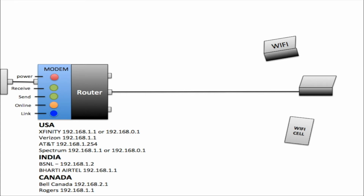Now this diagram is a basic representation of what your local area network would look like. Your modem would be connected to a wall jack with either a cable connection, which is the coaxial cable connection if you have cable, or a telephone type line if you have DSL. And now this is your modem. A lot of modems are combination modems, which have a modem and router incorporated into it so that you can actually have Wi-Fi. Most residential subscribers would have a modem combo like this one, and connected to the router side would be an Ethernet cable which would be going to your computer.